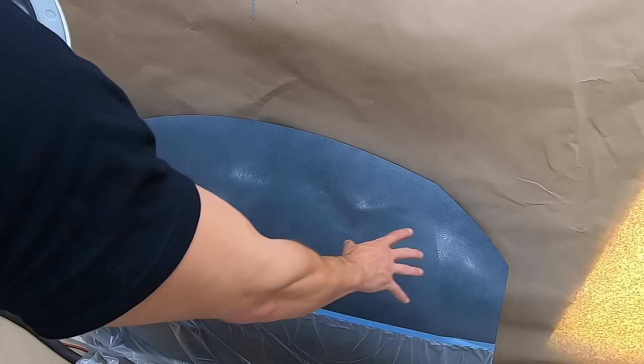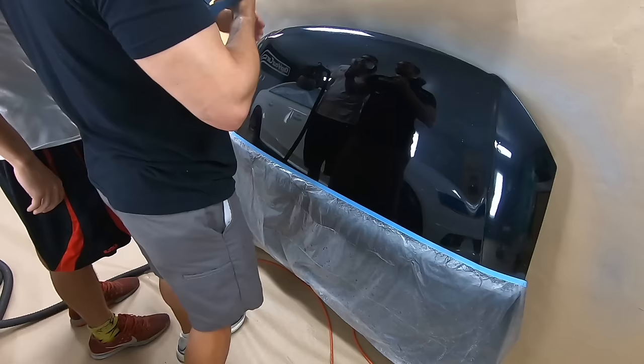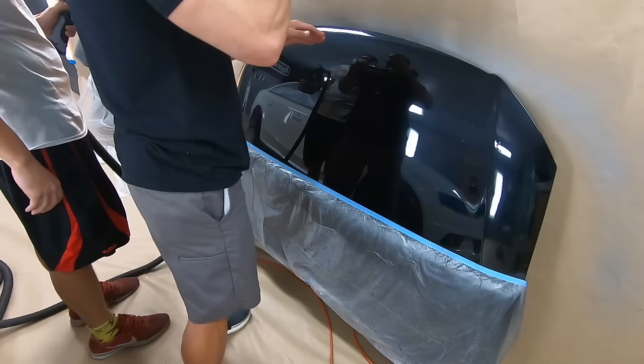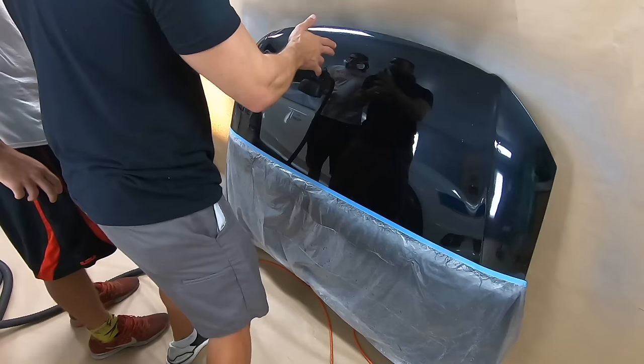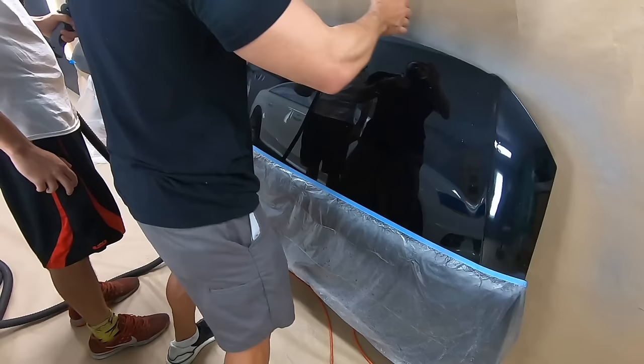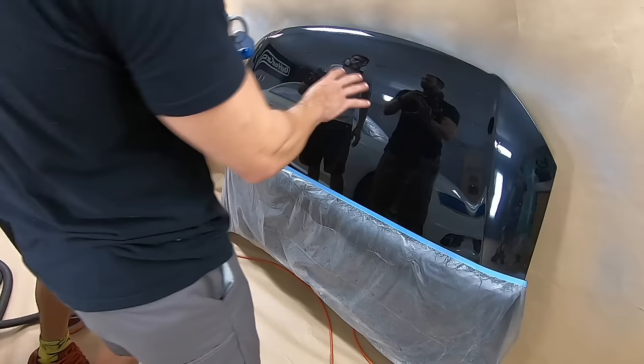Let's do that on your practice hood. So when we turn the turbine on, you're gonna spray up here, you're gonna check your spray pattern, make sure it's still the correct size. You're gonna try to remember to keep the spray gun perpendicular with the surface at all times. So if there's a little bit of a curve up here, you're gonna be just aiming a little bit down. As it starts to straighten out in the panel, you're gonna rotate that gun a little bit down. There's a lot to kind of coordinate at one time, but it will click. It's just a matter of your speed, and your distance and kind of getting that rhythm and always focusing on that 50-50 overlap. So again, for the first setup coat, we're only looking for about 50% coverage.